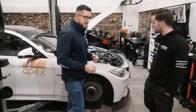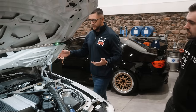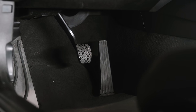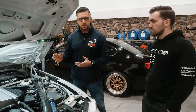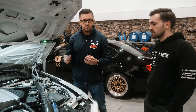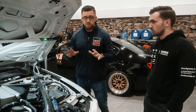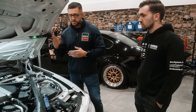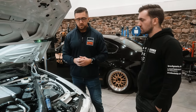So let's get started. What happens when you press the brake pedal? The majority of you should know where the brake pedal is — it's either in the middle or on the left side. In any case, when you press the brake pedal, it activates the master cylinder of your brake system. Most brake systems are hydraulically operated, meaning they have fluid inside them. Of course you also have brake-by-wire, especially nowadays with EVs, which are a lot more complicated. But for now, the basics: the brake pedal activates the master cylinder that pushes fluid throughout the brake system.